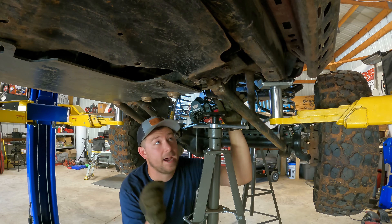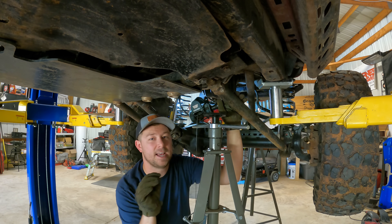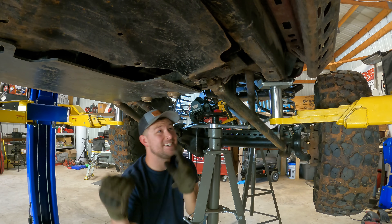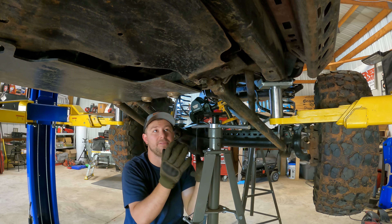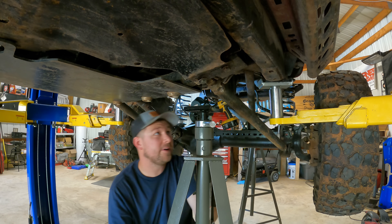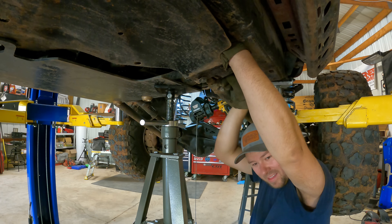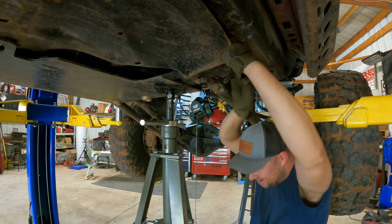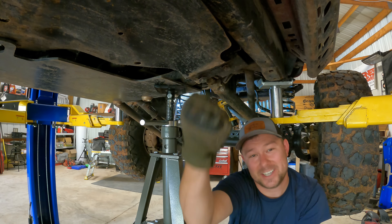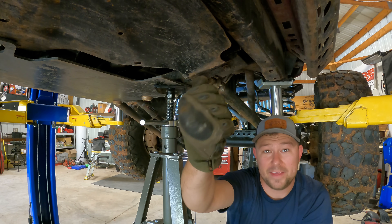The best option I think is to take those bolts out of the crossmember, clean that section up, and almost use the welding and heat to suck it in and draw it flush. So we'll give that a shot — I'm going to go support the crossmember and pull these two bolts out. By the way, if you guys are looking for a new set of impact-resistant gloves, check these out — I'll link them in the video description. I think they're called Freehand, and they're actually really good. They have knuckle protectors.